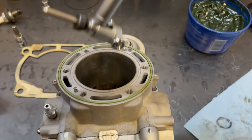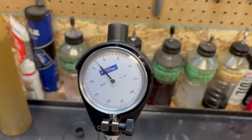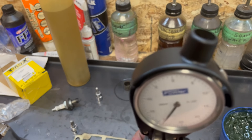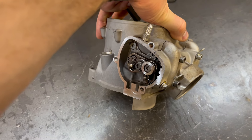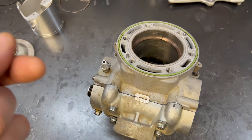I've got the cylinder all reassembled and everything — just checking clearance here. The bore gauge set to the new piston: two and a half. Very nice. Just over three, so we got just a little bit more than half a thou deviation on the cylinder wall. That is quite normal. Fast forward 12 hours. Before I got started this morning, I cleaned off my bench and reorganized everything. I often like to do that between disassembly and reassembly. I had a bunch of oil and coolant all over my bench and I don't like working like that — coolant is nasty, it just makes it so I can't properly grab and feel everything with my fingers. If you want to see the full reassembly process on a cylinder like this, I didn't film it on this one, but I have a whole video exactly on how to do it — I'll put a link in the description.